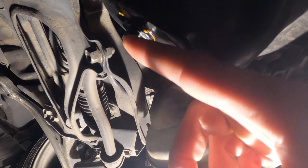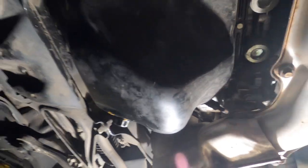We got the little GoPro down here. This is the oil pan, so we're going to go ahead — I believe this is a 17 mil — we're just going to take out this drain plug, drain the oil out. We got a little bucket down here, and then we can go ahead and take the oil filter off and try to get as much oil out of this thing as we can.